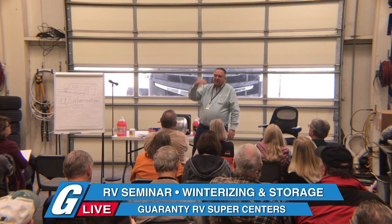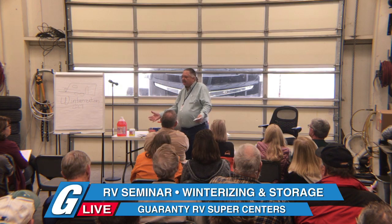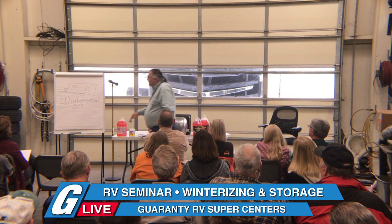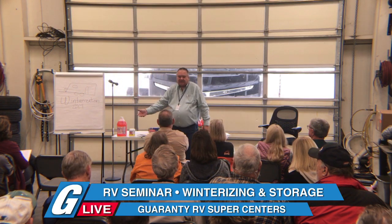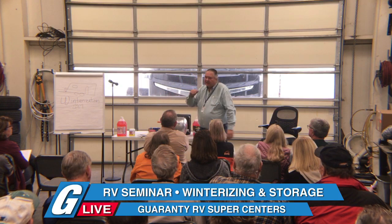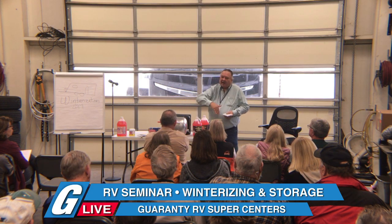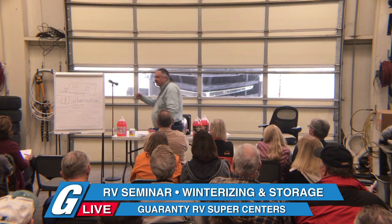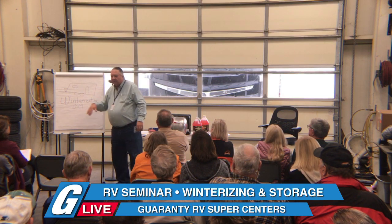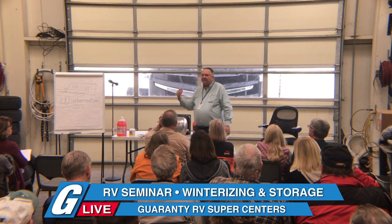Let's say that you go somewhere, you camp overnight, and it gets down to 27 degrees. It's 68 inside. The plumbing is always along the outside edges, unless it goes into the toilet or under the shower. So if you have your coach somewhere where it's going to get into the mid-20s overnight, you leave your furnace on, and you open the little inside cabin doors so that warm air can get in under the bed and places like that, it'll be fine.